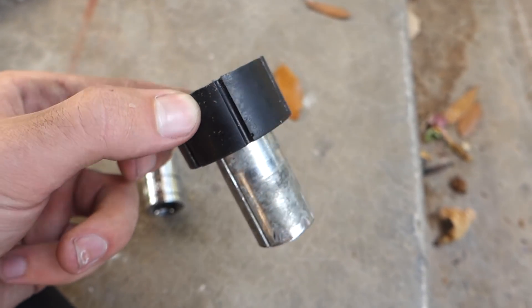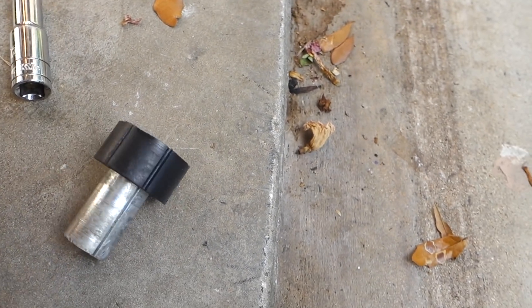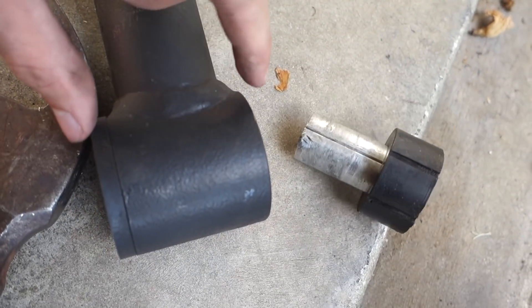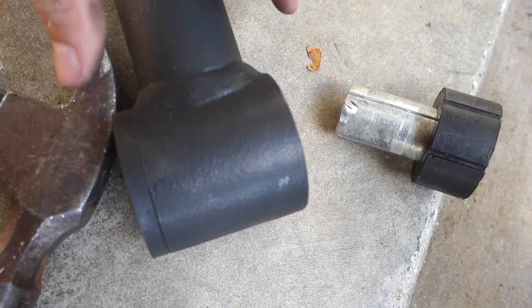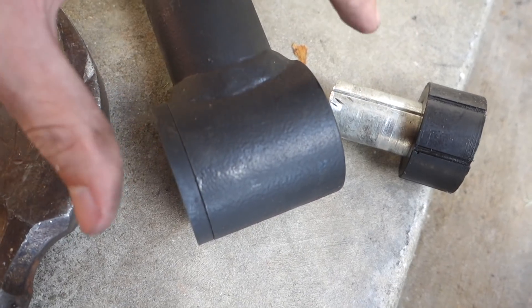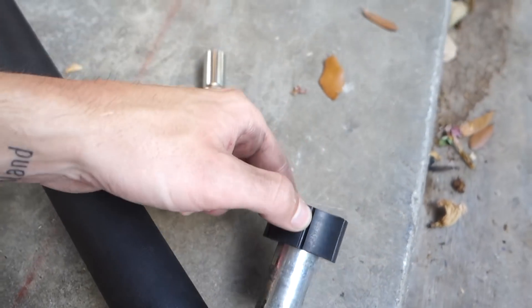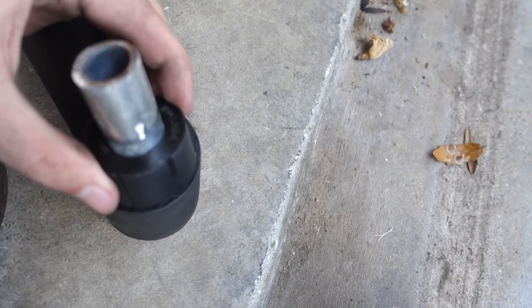I went ahead and trimmed this metal sleeve to size, and then I decided the easiest way would be to just cut the end off of one of these rubber bushings — I pretty much just cut this lip off the other side. So now there's not going to be a rubber bushing on this side. Honestly, if you know how four-link works, this is a really shitty design anyways. It doesn't allow for much articulation. It's not going to be much articulation anyways — it's not smart either way, but it's not going to be the worst thing in the world. So now I can go ahead and just pop this back in here.